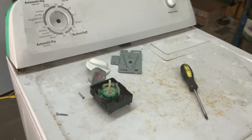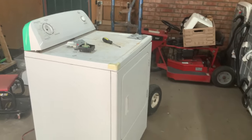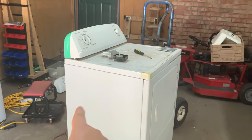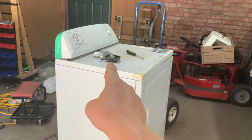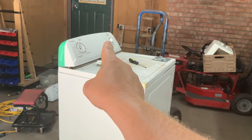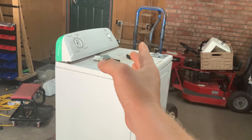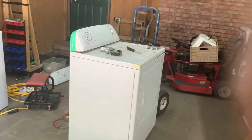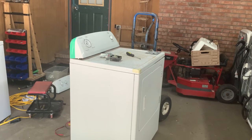Alright guys, that is it — that's my full test. I know it's a lot of words, but when I'm actually doing this I shoot through it really quickly: open the door, quick test, flip the switch, turn it, go to the back, pull those off, test, test, test. If that's not it, open up the timer — but don't test the timer, I just open it up and look to see if it's messed up inside, it's just faster. The last thing I usually check is the actual starter switch, because that's the last thing that usually goes out. Strangely, you'd think that goes out all the time, but not as often as you'd think. If this video helped, please like and subscribe. Sorry I didn't have a camera person with me today so I had to hold it myself. Any questions, put them down in the comments below and I'll try to answer them for you.